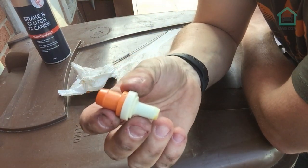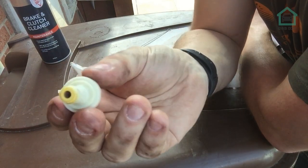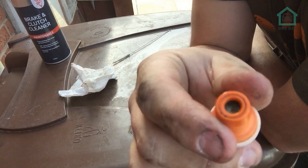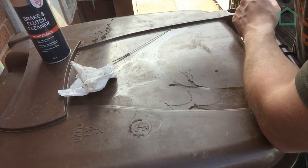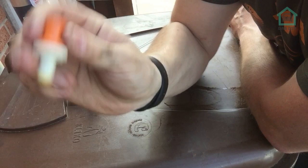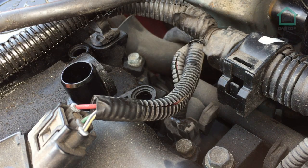There we have it — one clean PCV. As you can see in there there's a little spring and a little film inside. That sounds far better than it did. I'll just shake out the remainder of the brake cleaner and contact cleaner and watch it flash off. Then we'll throw that back in the car. I'm going to give this area a quick clean up, then pop it back in and pop the pipe back on.